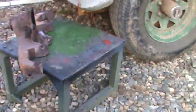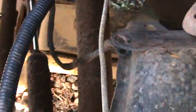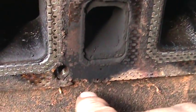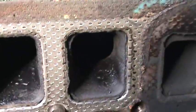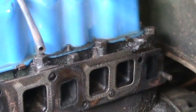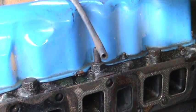The gasket blew out and it was just insane. I tried snugging all the bolts up but it was blowing out so bad you can't even drive it. I can take a little bit of an exhaust leak, but not a whole lot — and this was a whole lot for me to go into all this trouble. I removed the motor mount in order to get to that flange. The exhaust gasket was burnt up — you can see the exhaust is blowing out down here; it should never go past. That's the way it should look when it's clean. It's blowing out everywhere, and that causes poor fuel mileage too. Exhaust dumping everywhere where it shouldn't be — it just doesn't run good.